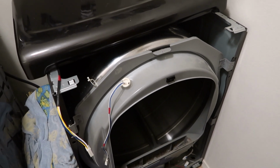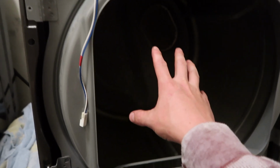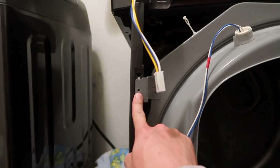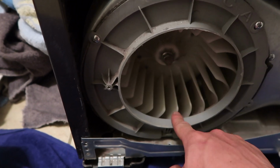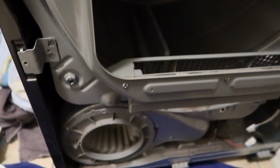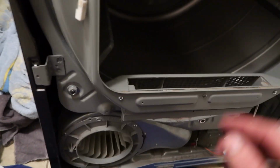Another helpful tip is when you've got to this step, you've put your front plate on, and you've got the fronts in the wheels. Before I even put the screws in, I'll go ahead and spin this and make sure that everything spins free. I've got the belt on there. I can hear the motor kind of whipping around down there. You can also tell if the motor's connected because there's a direct shaft between this exhaust fan and the motor. And if you're spinning this, the motor will also be spinning. So if the belt's on correctly, this should be spinning.